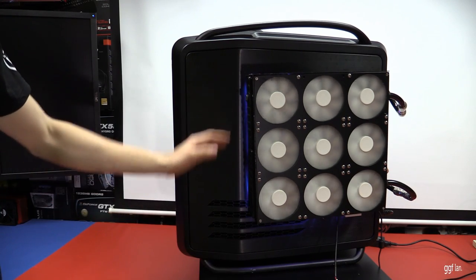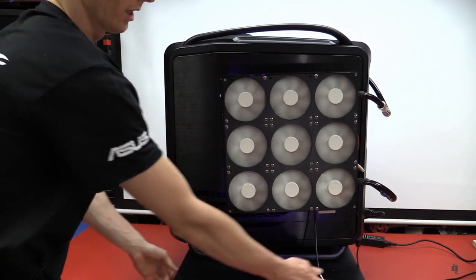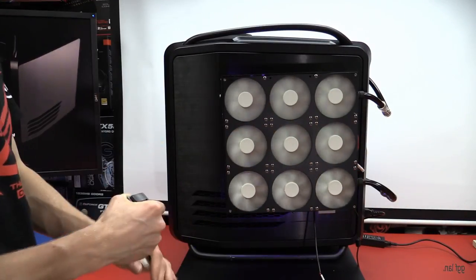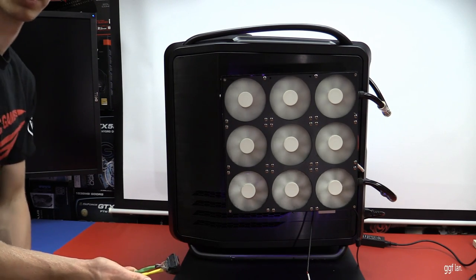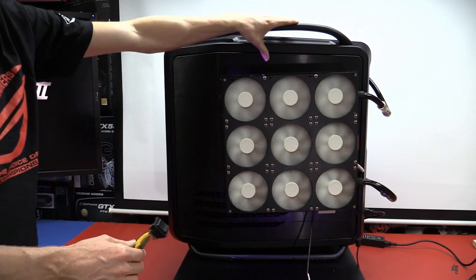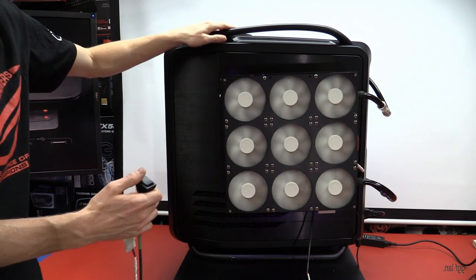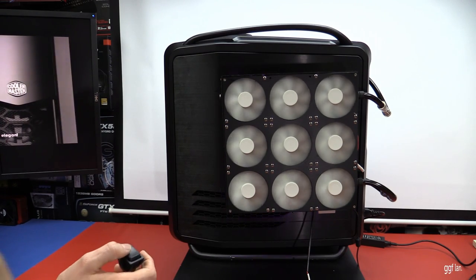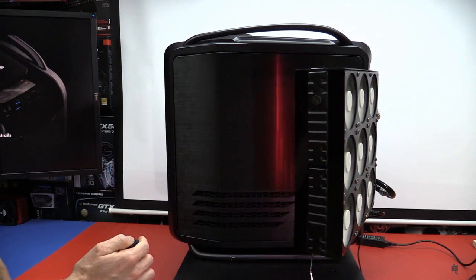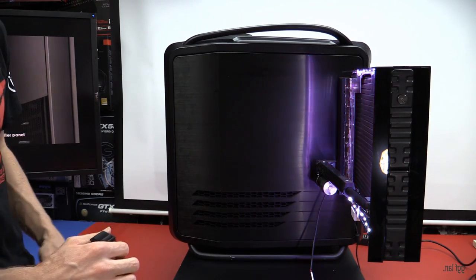The radiator is running really low RPM fans — I've got a heap of them so I don't need them running fast. I've actually fitted a 24-volt electronic actuator — you can pick these up cheaply on eBay. If I'm going to put a massive radiator on the side panel, I thought I may as well do it in style. I've got an LED strip in the back. Now I can swing this open and it can go full 90 degrees out.